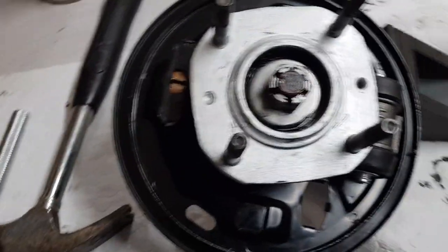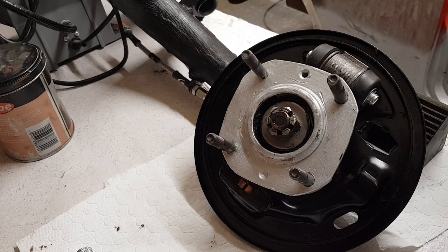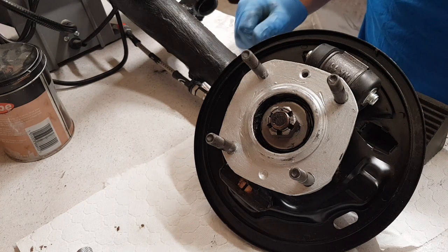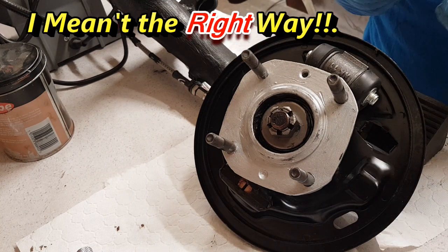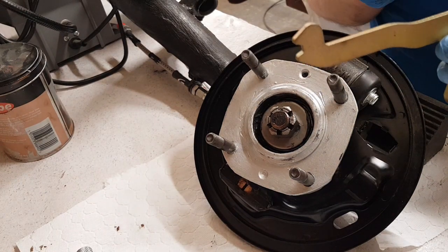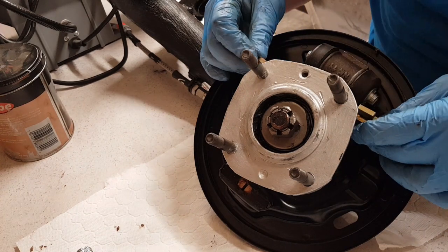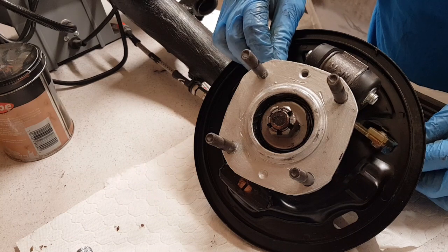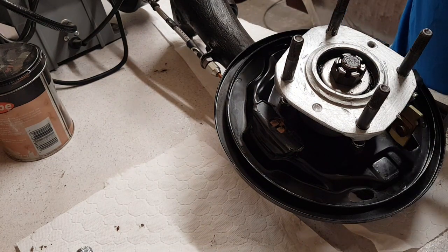Nearly finished the radius arm, I've just got to install the brake shoes. With the brakes, if you're not sure how they go back on, take plenty of photos or you can always leave the other side on so you've got a reference point. The handbrake here - make sure it goes on the right way, it'll save you a lot of hassle later on. The way I remember it is this bit here sits up and looks like a duck. It can only go one way - once you've done a few you'll know. It's a lot harder watching someone do it than it is to actually attempt it yourself. If you can put that through there first, it gives you a good reference to how everything else goes.